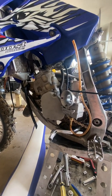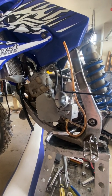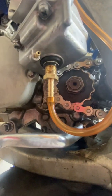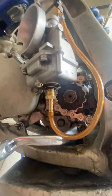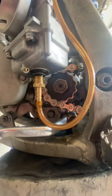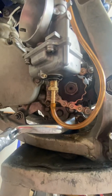Got in the service manual, going through and figuring out what it could be. Looking at this float bowl — the float bowl is obviously a lot more shallow than most. So I rigged this tool; you can buy the tool from Yamaha, but I took an old water pump seal, screwed it in there, and then I've got an air fitting from an air hose, put it on there, and then just took some fuel piping, put it on there — and it works good.